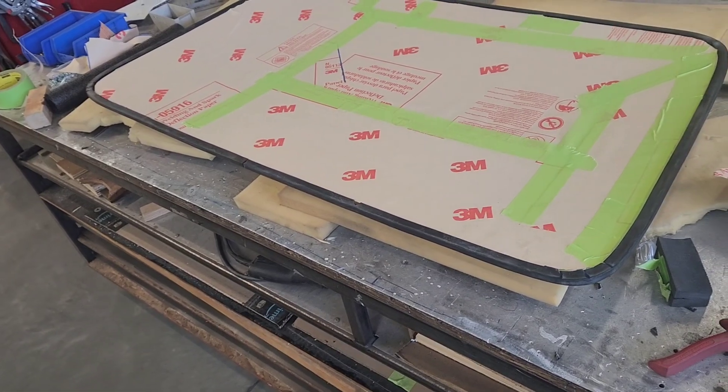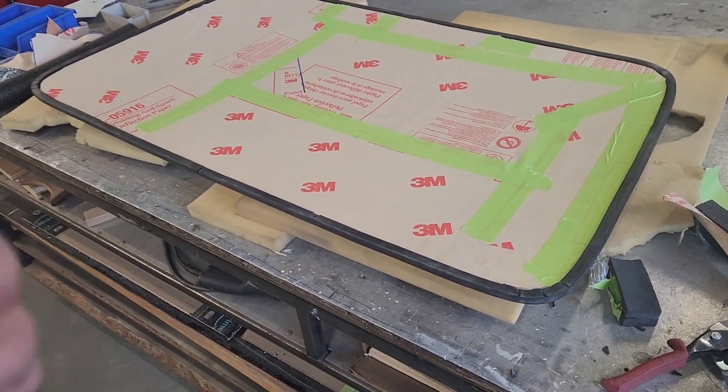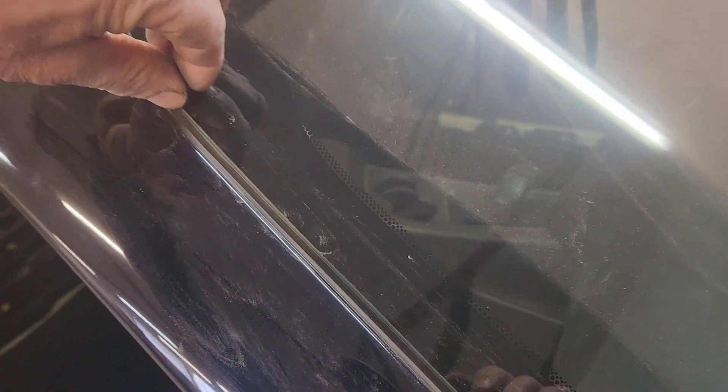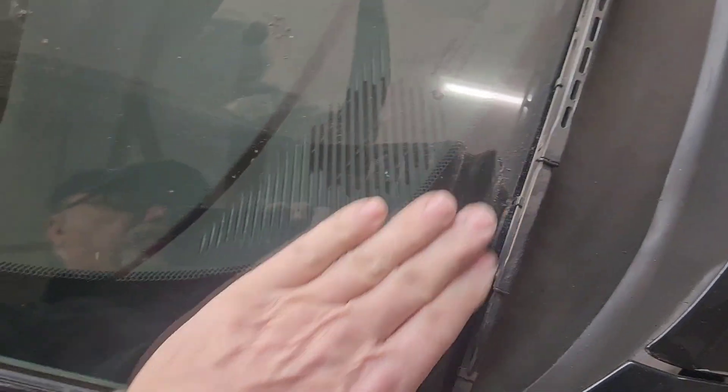I've got the actual bead coming for the final installation, which is a quarter inch thick and requires about a quarter of an inch space around the side of the opening. This is what it looks like - it's got a little lip that takes up the space between the glass and the bed. What you can't see is underneath, on the other side of this black frit, there's a quarter inch thick self-adhesive band that sticks to the back side of the glass to protect the edge and set it up off the actual bed so there's a space for the urethane to spread without smashing it flat like a flattened peanut butter sandwich.